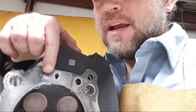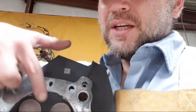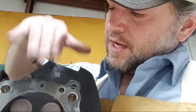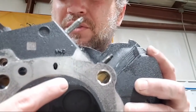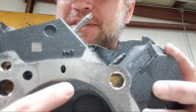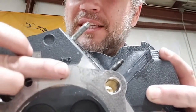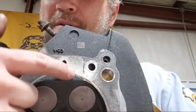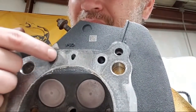That's the problematic area. You'll also notice where that square is — that's where your head gasket has a metal shim in this area to try to keep that sealed up. This area is also where you're seeing a lot of M8s with a gasket slipping. If you look right there, you can see where the carbon dips out. I believe what we're seeing is that head gasket starting to squeeze into this area and get something down in there — you can see the smear being pulled. I think it's kind of obvious in certain light. Guys, have an awesome weekend. Take care of yourselves and each other.